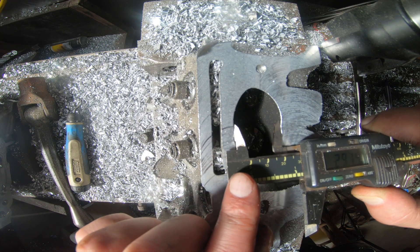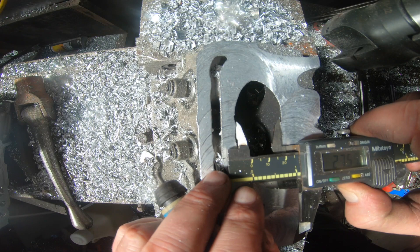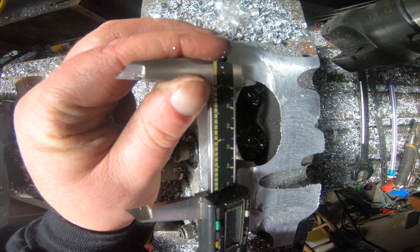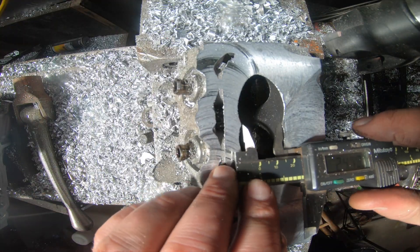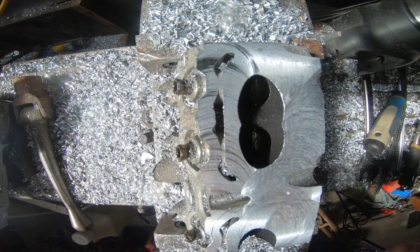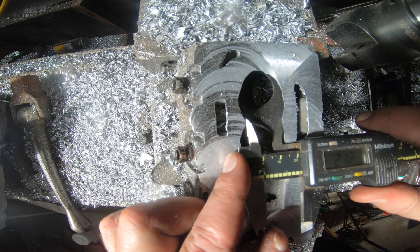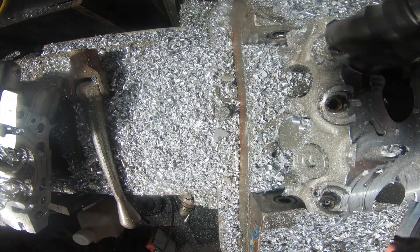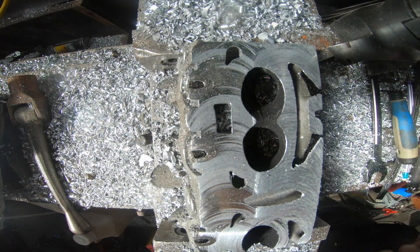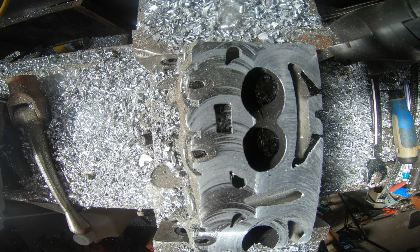45.9 wide and it's starting to pinch out in the middle there — 29.16. 27.5, 51.6. 56.8 wide, 25, and 28. 27.6 and we're getting another smile shape. You can see as we're starting to get into that short radius — this is where we had seen before — there's just 6.35 millimeters, so exactly a quarter inch of material there. Not sure how comfortable I'd feel knocking that down too much on the hot exhaust side. And by the way, we're 60 millimeters down.